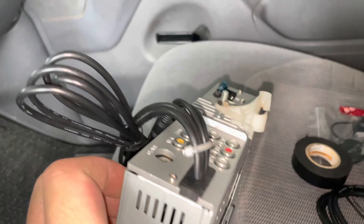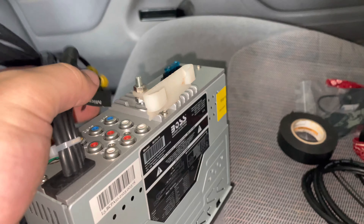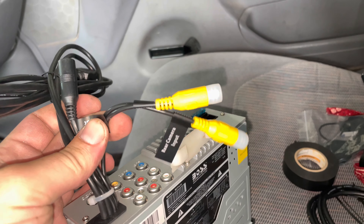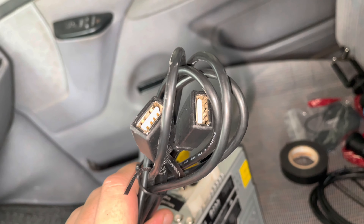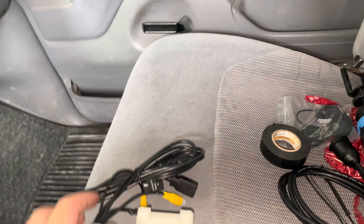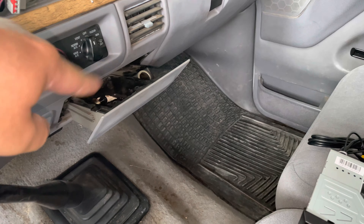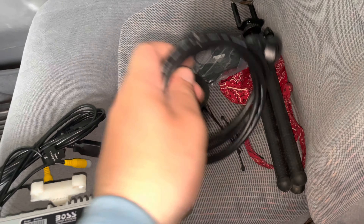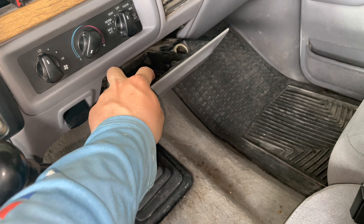All I did was I modified it a little bit, drilled the hole through it, and then bolted onto this bolt. This radio has two camera inputs — a rear and a front camera — a microphone input, and then Apple CarPlay and a regular USB port. Since it has the USB and Apple CarPlay, I'm going to be removing this cigarette lighter out of the ashtray compartment and installing a USB plug in there. And then I'm going to be making a phone holder right where the ashtray is.